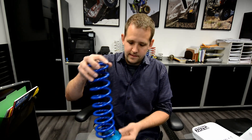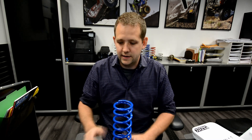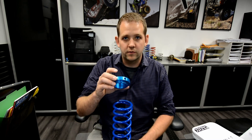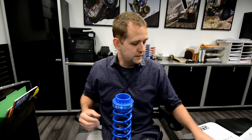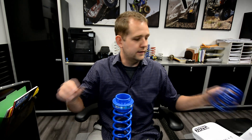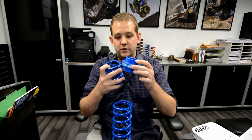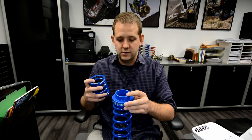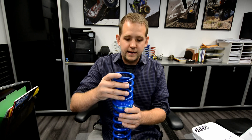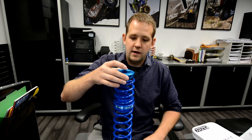You've got your lower spring plate and the spring sits on top of that. In a single spring setup, that's all you have — you'll have your upper coil nut that comes down and snugs it up. In a dual rate setup, which is what we typically see, you'll have a slider in the middle. If the slider has two different heights, the taller part points up and stays on the shock cylinder. The second spring sits on top of that, and then on top of that you have your coil nut.